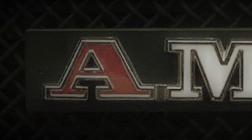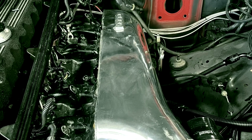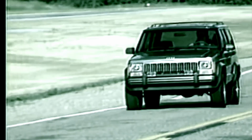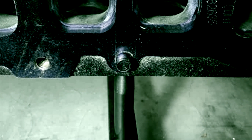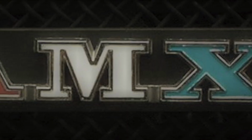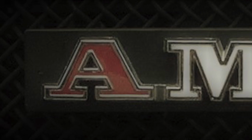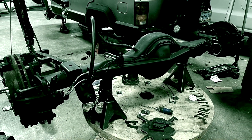So they said, we've made this girdle that we're testing. So they gave them a girdle and told them what the torque should be, and gave them the bolts, and they put that on there with the special locking nut. Well, that problem's gone. They came back and said, the problem's gone. You fixed it. And they said, we noticed our bearings look better, too. And once I saw that, I grabbed one, brought it right to Garth, and said, here, put this on the engine.